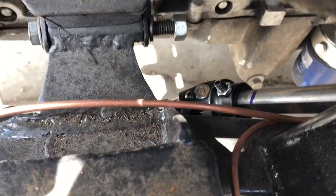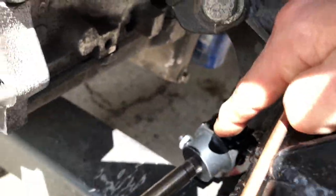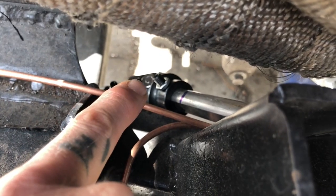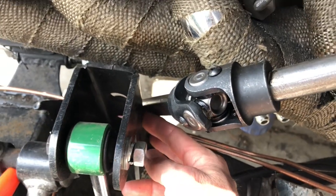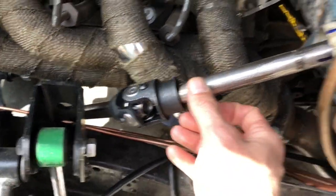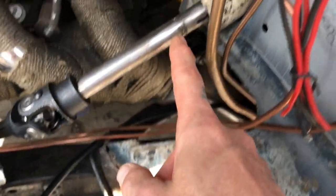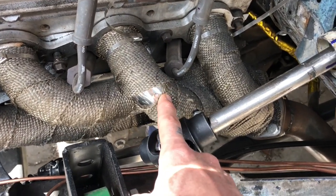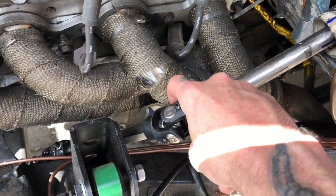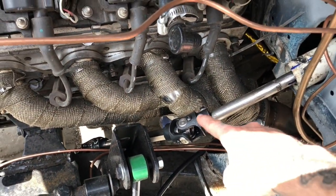We got the output spline and a 2 inch long piece of D shaft connecting the two together, so it kicks out a little towards the motor and then comes up next to the shock. It's kind of hitting a little, but this is still free to move. This ended up being shorter than the recommended length because I didn't have my first knuckle start here and go down — due to this header pipe being in the way. I may still have to dent this header a little to make sure I don't have any clearance issues right there.